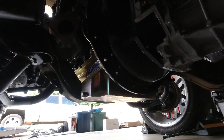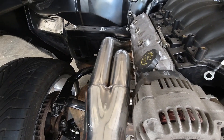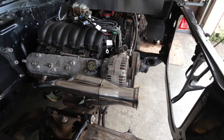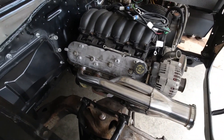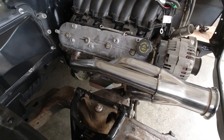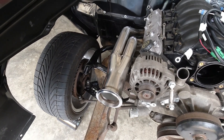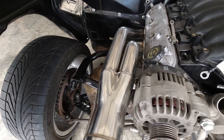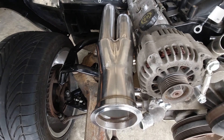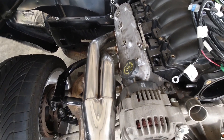Now, what I'm not going to use anymore: forward-and-up-facing exhaust manifolds or cheap eBay headers. There's no reason to frustrate yourself with them — they don't fit well, they put heat up higher, and no matter how well you wrap them or ceramic coat cast iron manifolds, they just don't fit that well. You can do a more custom job and move the turbo around a bit, but you'll just end up frustrated. For the money you'll spend on the Fairer exhaust log, there's no reason to do it any other way. You may save a few bucks with this style, but there's no reason to frustrate yourself — Fairer for the win.